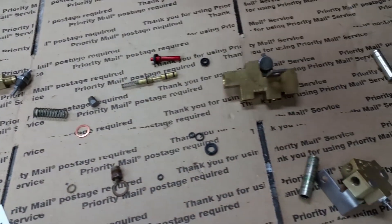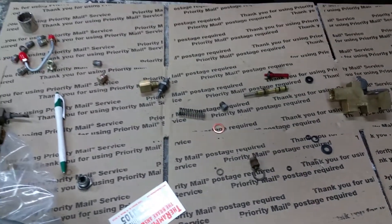There's a lot of people on these forums, and there's been a lot of debate over the years. I'm just going to tell you the facts. After messing around with brakes — me and Uncle Ron and Joe for 40 years — we know what's going on, and we don't need a forum to tell us. DOT 5 brake fluid is a low-performance fluid. It's not used anywhere in racing. As a matter of fact, it's one of the few fluids that has so much oxygen in it, it actually has compressibility.